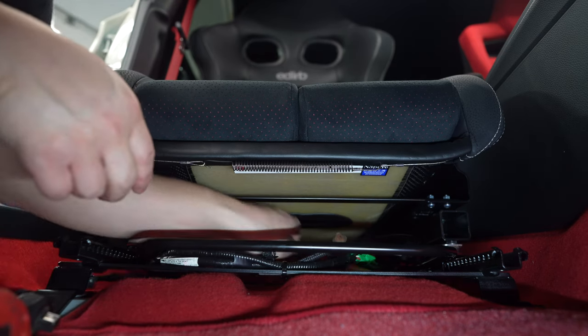We're back from the dealership and all done — no more check engine lights, no seatbelt lights, and no warnings. This is sick, I'm so happy — it all worked out. We had to take it to the dealership and it did have to get recoded because it just won't initialize with a basic scanner. So you do need the dealership to do it. If you're buying new sensors that are not from the actual car, you will need to go the same route. But if you use the original sensors, they will work.